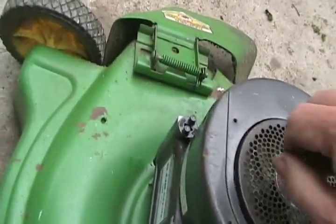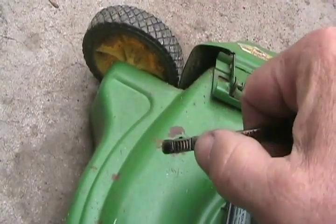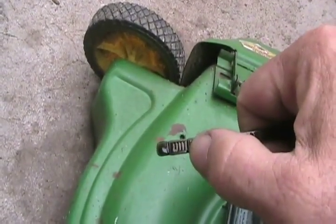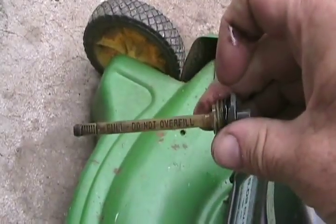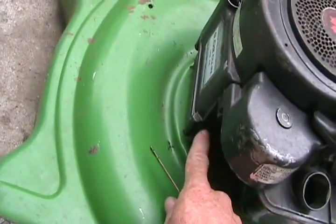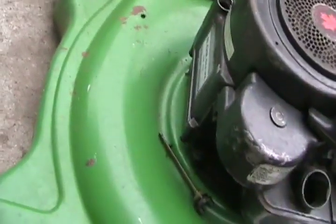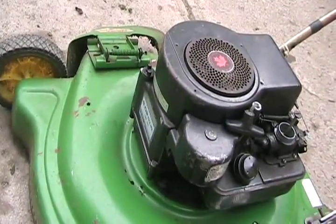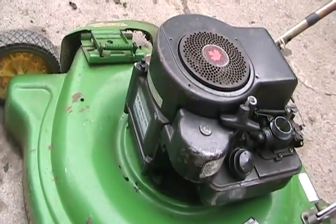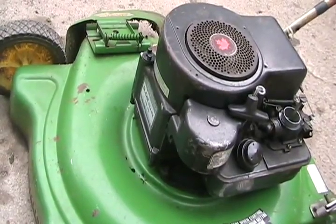Time to check the oil. On this model, the maximum depth is at the top of the dipstick when the dipper is screwed in. If you have the other model with the cap down here, you fill it up to the top line of the opening. Almost any small engine, including this model, uses half a liter of oil when it's completely empty, if you need to refill or change your oil.